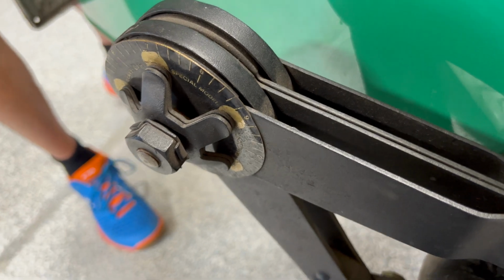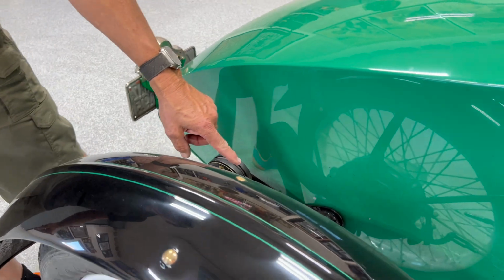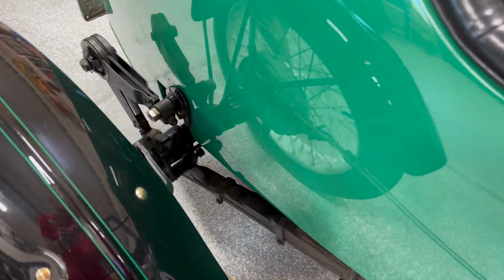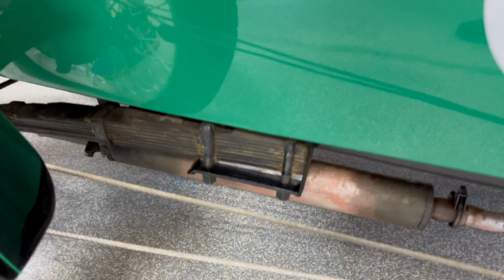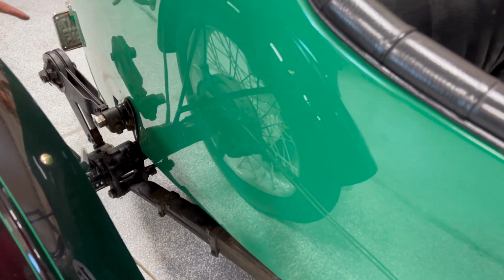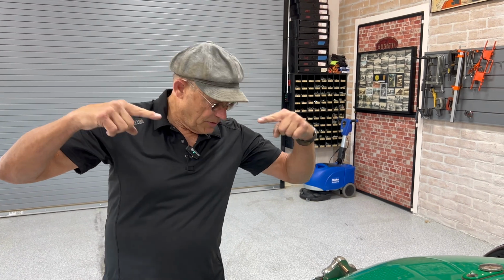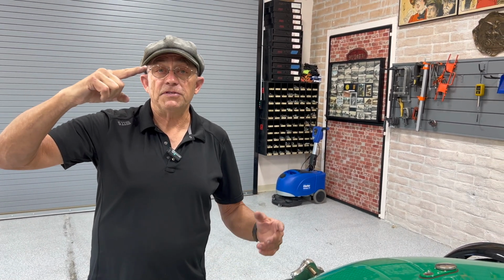So this is a pretty long travel car. Also, notice that the spring is only a half spring. It's just half a leaf. It starts in the front, and there's no coupling or end to the rear. If there was a leaf spring and you had that short of a distance, you might have 2 or 3 inches of travel. But because you've taken this one away and this one is free, you have 7 or 8 inches of travel.